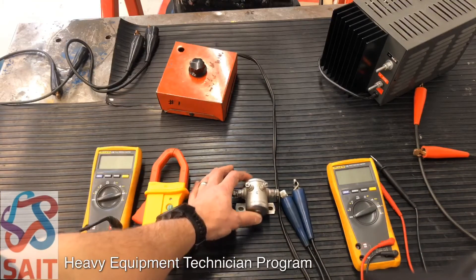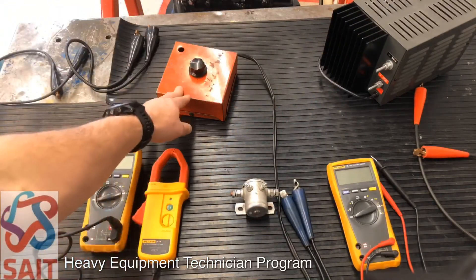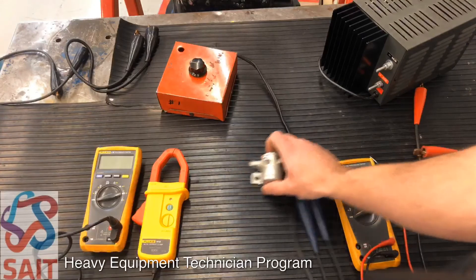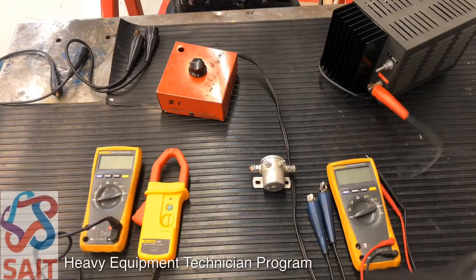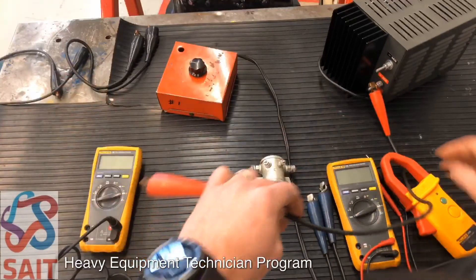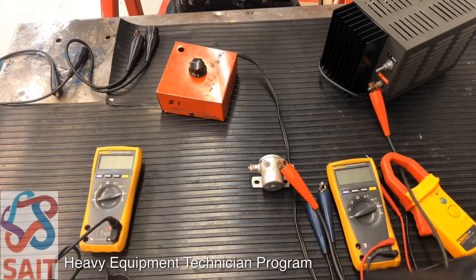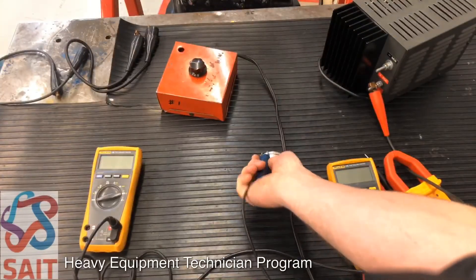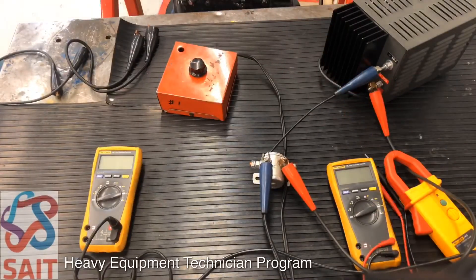The workbook tells us we're going to set it for a six-volt starter relay. We have a 13-volt power supply, so we need to use the carbon pile to drop the voltage down. Our control circuit is right here — we'll use our power lead, run the amp clamp in series with the carbon pile leads, and run that back into the ground. That's essentially how you'd have that set up.